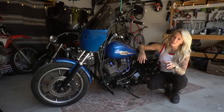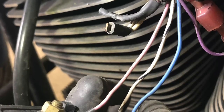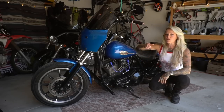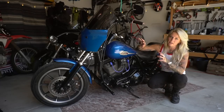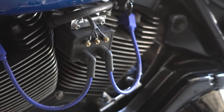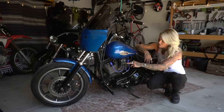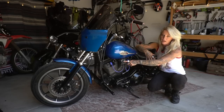A big issue I was dealing with last summer was a lot of wiring problems. The wires were 25 years old — props to this bike that they held up as long as they did — but I had a lot of small wires breaking. So Nick went through and did a full rewire of the entire harness. On top of that, a clever idea from him: he actually flipped my ignition coil so you can see the cables, which are a lot of times your problem. Super simple, but you still have to take it off. Now if I do find myself stranded, I can quickly see whether or not it's those three cables.